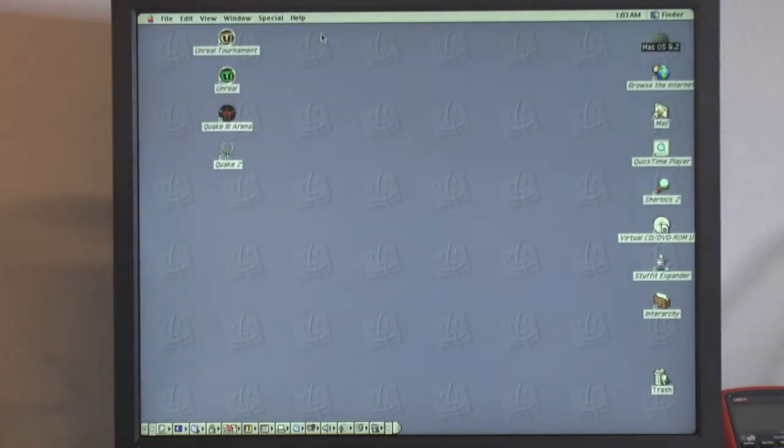Now I have configured these games, the ones that worked, and I expected Quake 2 to work with it, but there's no Glide option anyway. I have patched it, but it seems like it should work. It defaults to the first card, the main primary card, and the readme file says for that patch you need the beta 11 drivers, and the highest I could find was beta 10. But I didn't try those. The one that seems to be recommended is beta 5. So it just seems like I can't run Quake 2 with that.